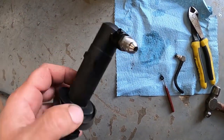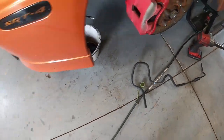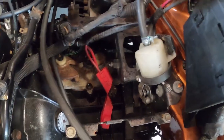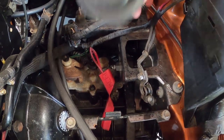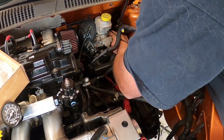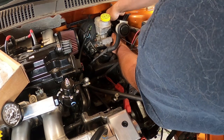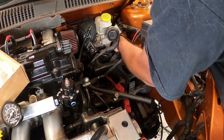We got the slave installed. Like I said, I cleaned it out, wiped it — I actually put a little bit of brake fluid on this end before I pushed it in for the seal so it had some lube. Here is our old line — I just grabbed hold of it, untwisted it, and yanked her down out. Now I have the master cylinder back up in here. I ran the line down underneath. You want to make sure that you tighten the line onto that fitting — now that fitting will spin in the cylinder, just make sure that you have everything where it needs to be when you're going to reinstall this. It's kind of pretty much the same way it came out — an extreme pain in the you-know-what. No worries, it can be done — it came out, it's got to go back in.